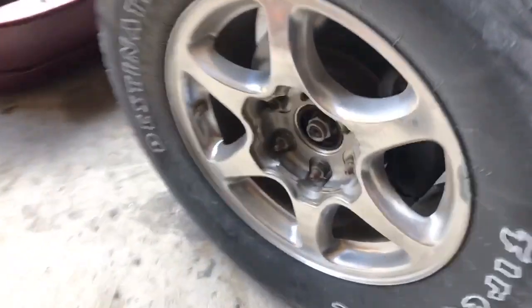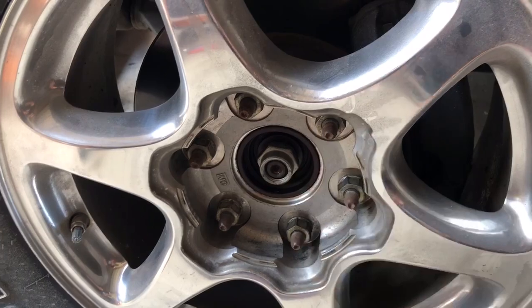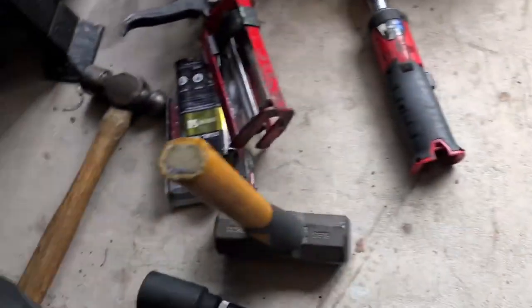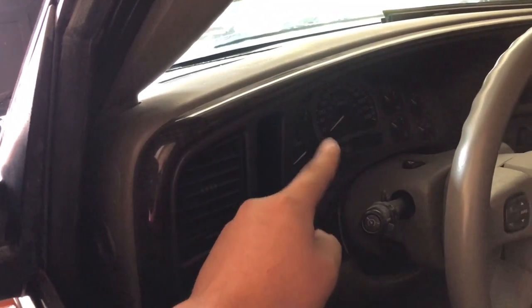We gotta get rid of these stock wheels - can't wait for those SS wheels to come in, they've been on back order for a long time. Yesterday before I left work I soaked the antenna down in WD-40, then when I got home I broke it loose with a steel rod against the center so I wouldn't damage the threads, and it came out pretty easy. I also got the doors detrimmed - doing the cluster, replacing the one stepper motor that's not working, and doing the door speakers. The wipers and stuff on the back aren't on because those pieces are going to get painted.